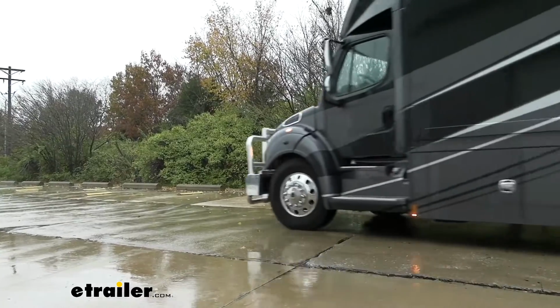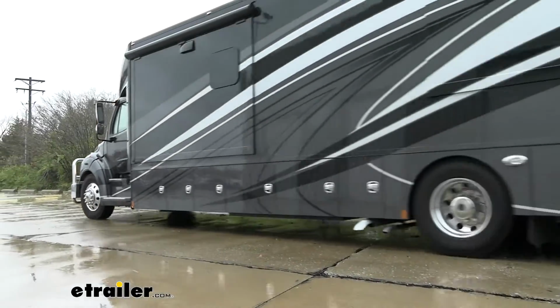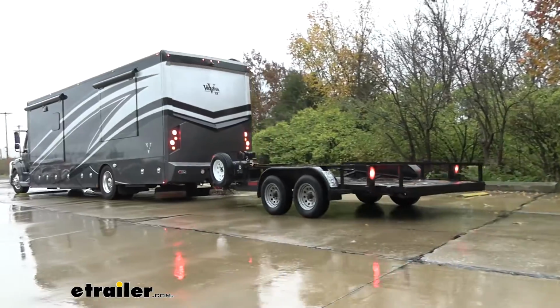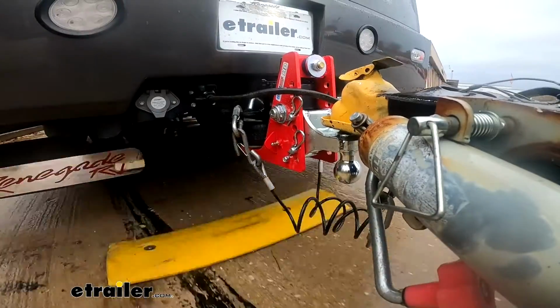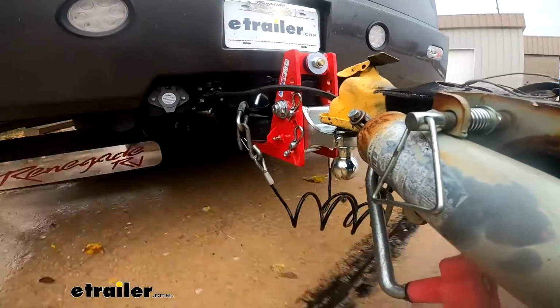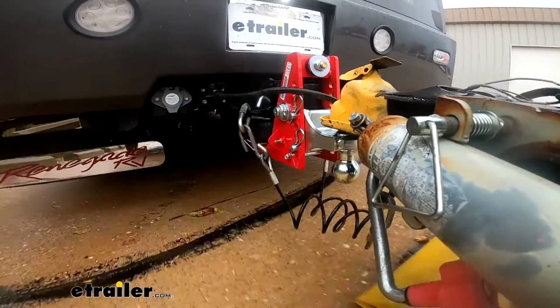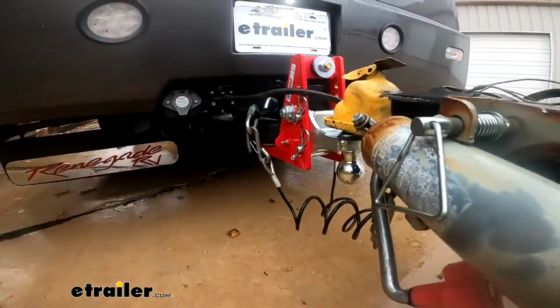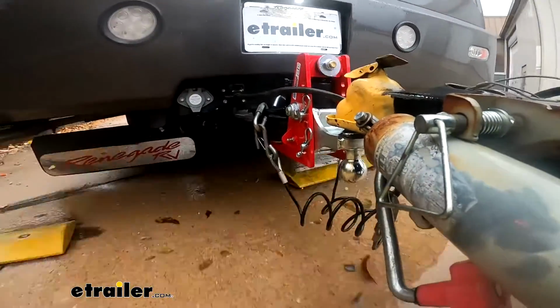So when adding suspension, obviously it's going to soften the blow between things, and suspension upgrades are great, especially for an RV, but a lot of times people think about the trailer and just go, well, that's just pulling a trailer, but that's not the case. The Shocker Hitch actually does a really good job of adding suspension at the point where you're hooking up to the trailer. So all that bouncing around on the tongue and coupler is going to be softened by that airbag.